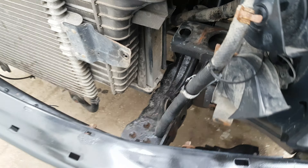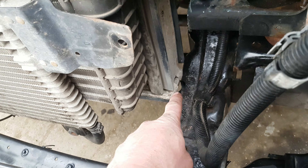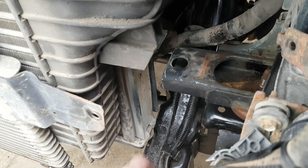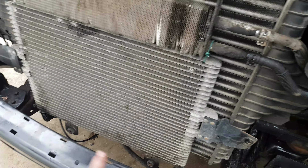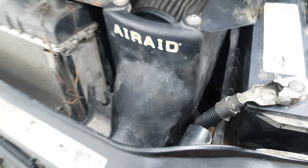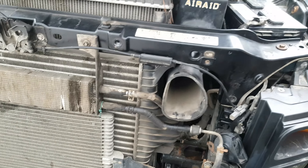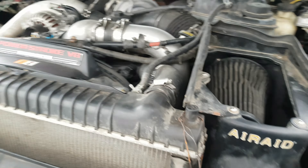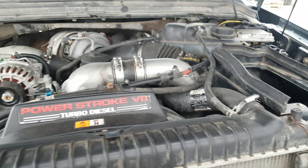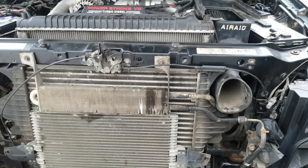I still haven't built my support yet — it's just kind of dangling in there and resting on the frame. The radiator is too wide to fit between the frame rails, and the body radiator support is totally different. You can't use the 6.4 radiator and intercooler because it's like a foot wider and gets in the way of the air box, so you'd have to relocate the air box and all the lines — everything's completely whacked. So you have to use the 6 liter radiator and intercooler setup.